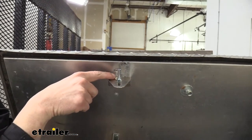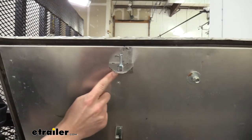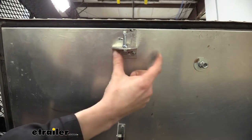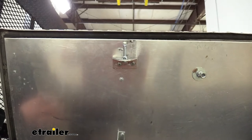This one here is fully adjustable. You can see the pin can adjust down the slot, and the striker bracket has a slot for its mounting as well. So once you get it mounted up, you do have some room to move it back and forth so you can get everything positioned properly to where it opens and closes smoothly.